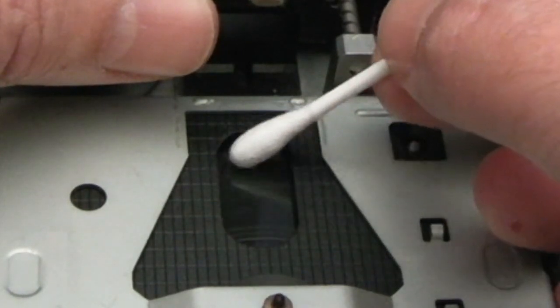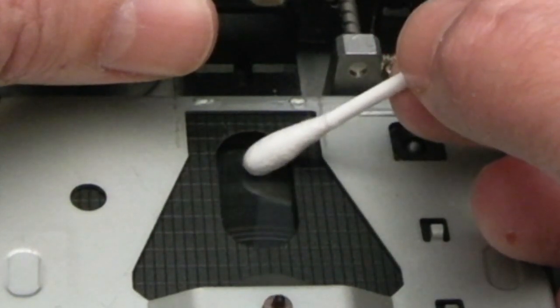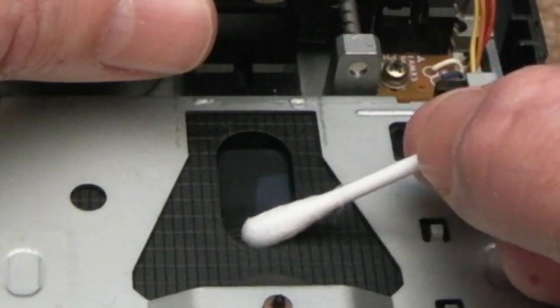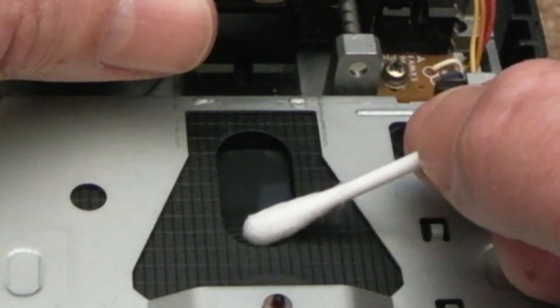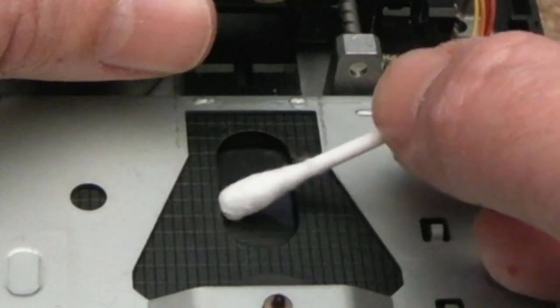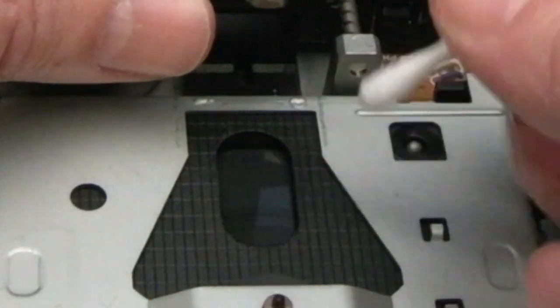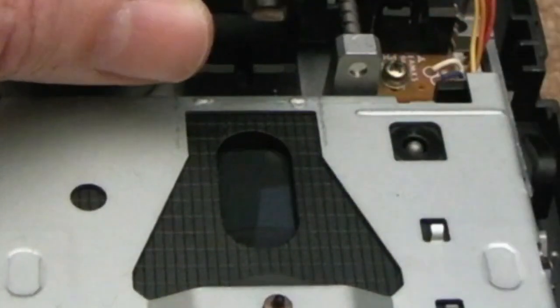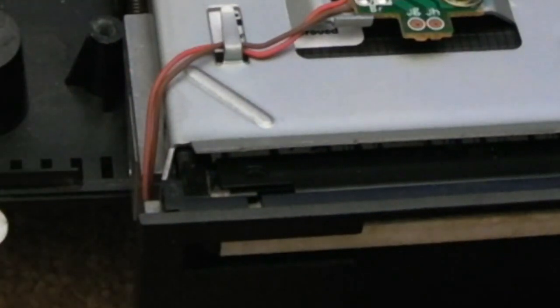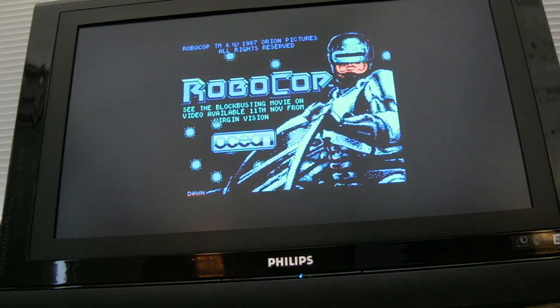You can see it's moist, then go over the dry end of the cotton bud — don't press too hard. Go up and down a number of times slowly. You can start to dry off at that part there. There's still a bit of moisture down here. You might find you can blow a bit of air onto it. Let's give that another try — you can see there's a blue screen there, it just did a reseek, but I think it's working. It's going up the tracks — will we get the loading screen?